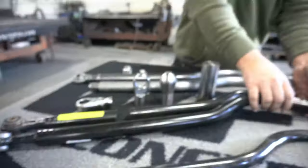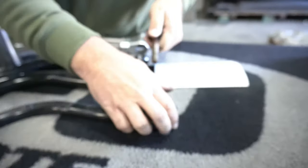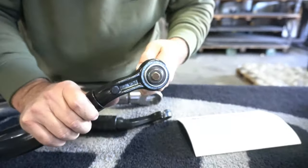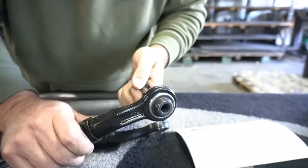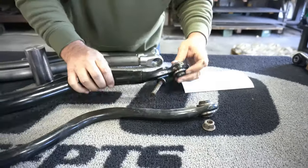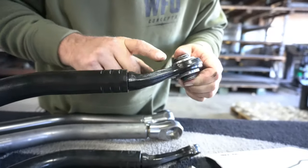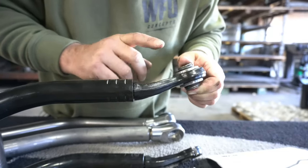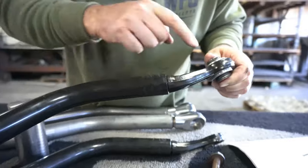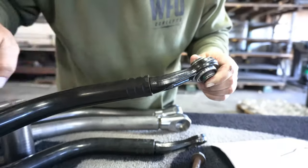Looking at this other end — the upper end also has a moving uniball, just like the JK had. This is up at the frame, and here's where it gets tricky. See this sharp angle cast into this forged part — I think it's a forged rod end that's wedged in. They have this sharp turn so they can clear the differential and have good clearance. That's why this bend is here.